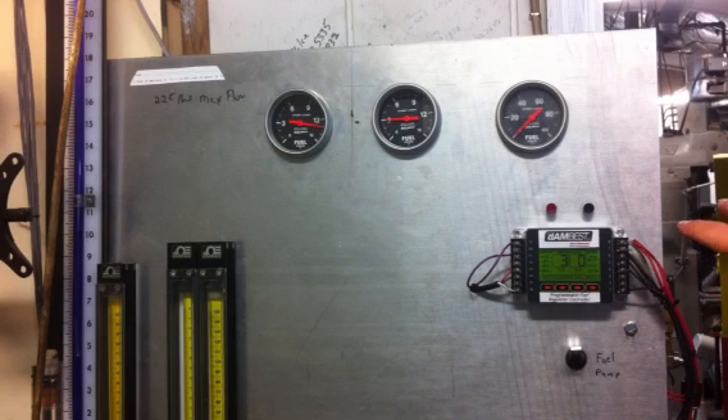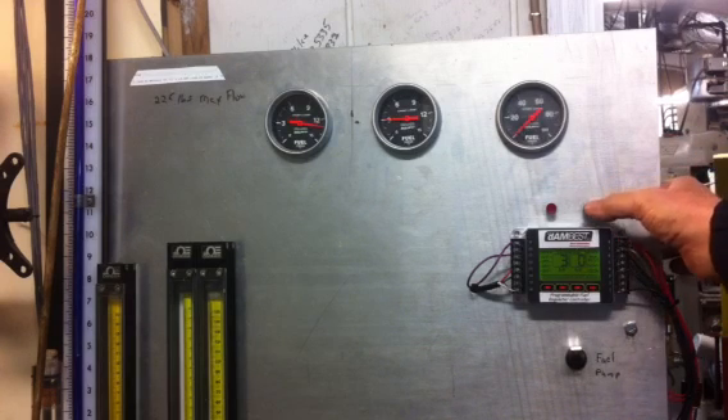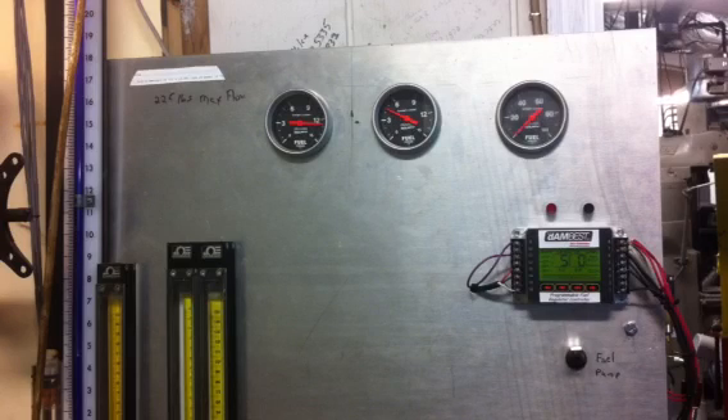So I'm going to go through the run again. You go in and hit the trans brake button, the tree comes down, you release the trans brake button — it goes to five pounds, then six, then seven, and then at the quarter mile it goes back. You can program any pressure at any given point in time, and there's a multitude of adjustments in this.